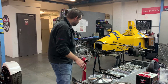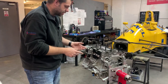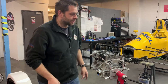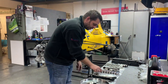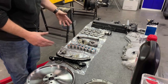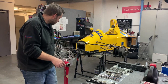Here's the rest of the engine still to go together. Rods and pistons are in, everything's been checked, all clearances measured, the block re-honed. I'm just waiting for the cylinder head — my colleague Will is just installing the valves back in. Once the valves are back in, we've got the cam followers to drop in, then we'll drop the cams in. We've got to check and shim the cams — there may be some adjustments needed — then we can look at timing the engine back up, timing cover, rocker cover, sump, etc. The plan is to have that done by end of day.